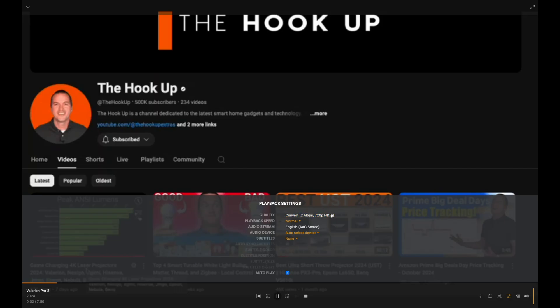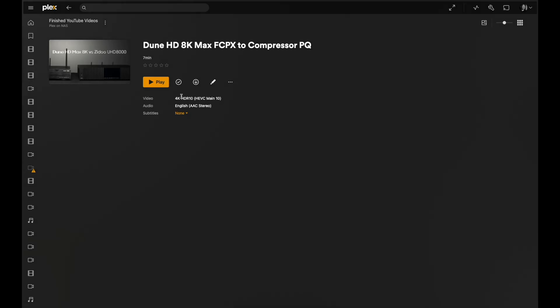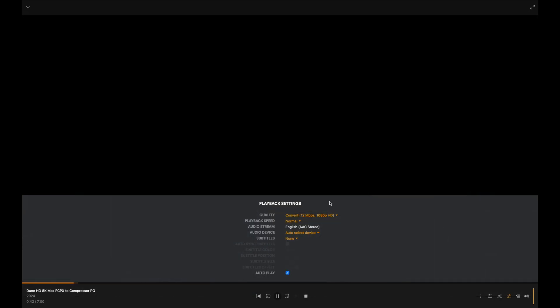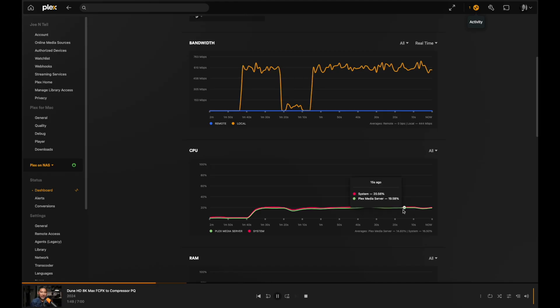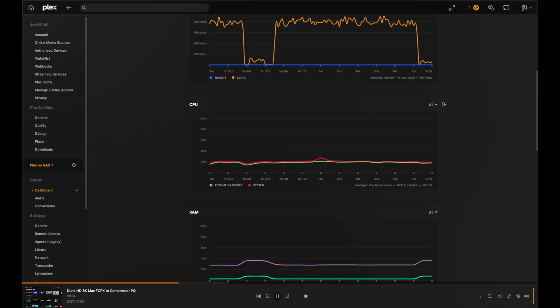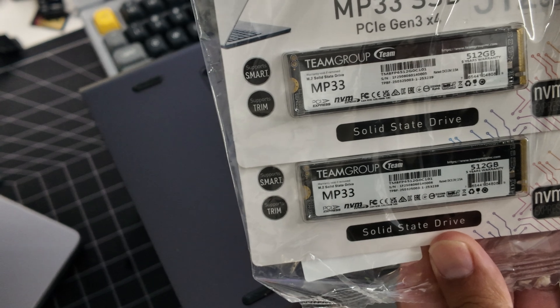Let's try it with 720p — no issue. And let's try 320p — easy. That was a 4K SDR video. Let's try this 4K HDR video — plays instantly as well. Transcode takes a little bit longer to start, but it works, no problem, no stuttering. With direct play there's no transcoding, so there's no issue. If I transcode to 1080p with this 4K HDR, you can see there's still no issue. CPU usage is low and RAM usage is still low.